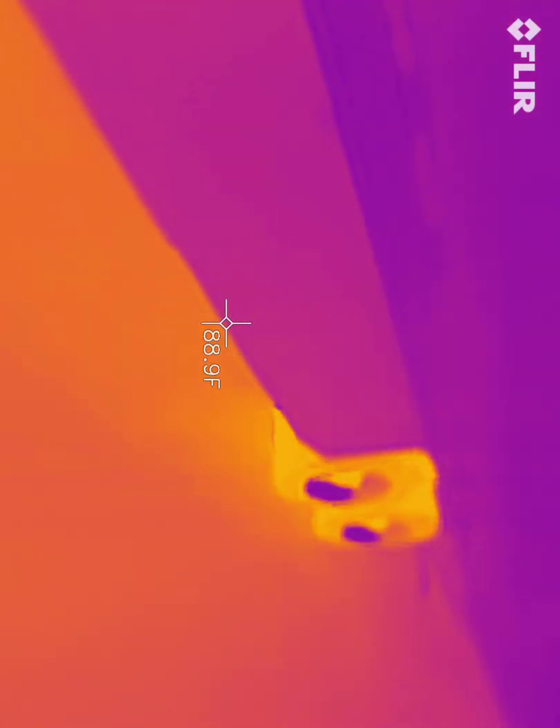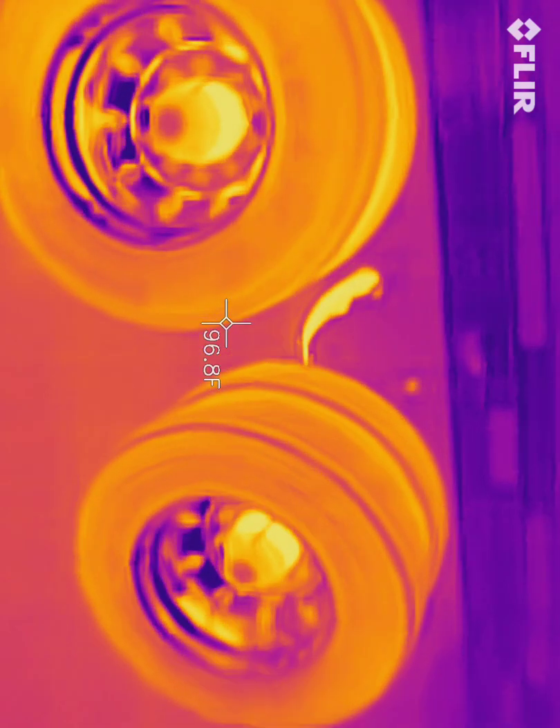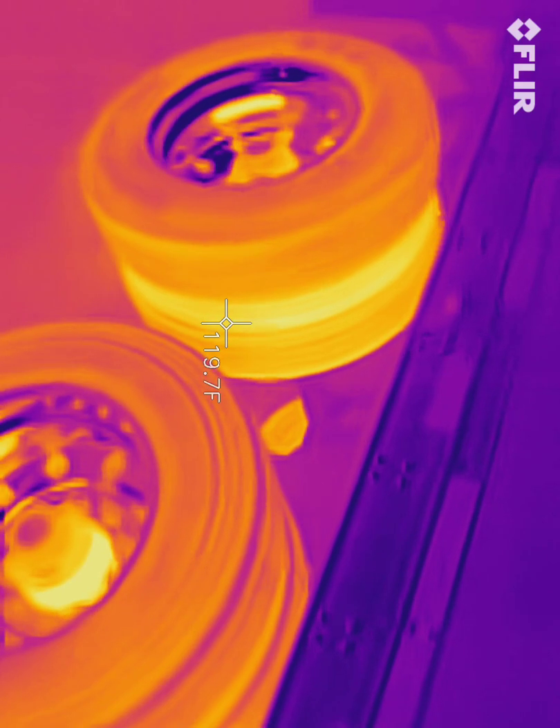We're coming out here to take a look at my tires, because I was having a tire issue earlier tonight. After it recalibrates, you'll notice that my tires are nice and warm. I can get a spot temperature there — 102. Now, that one in the back looks like it's about the same. Except we've got one on the front here that's a good 20 degrees hotter.